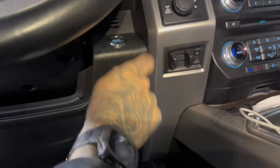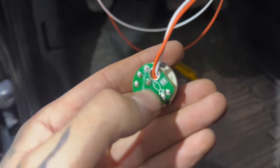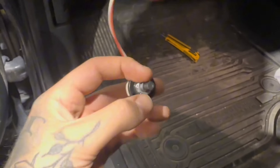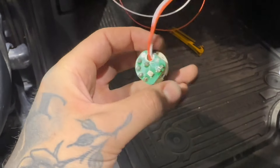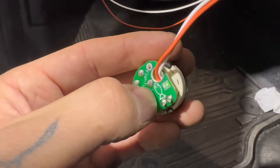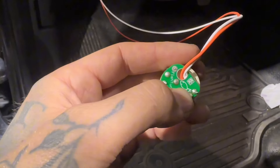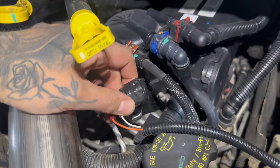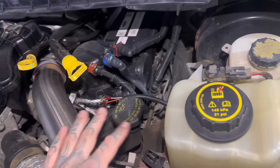Before buttoning it all up, let's make sure the switch works. Come into the truck, turn it to run, grab the switch and press the button — you'll see the green light turns on. Make sure it's all the way in the number one setting to the left; as you rotate right and press it, the green light gets dimmer. Rotate a couple more clicks and it's barely visible — we know our switch is working. Back in the engine bay, leave the sensor unplugged and tape it up to keep it covered, then zip tie the cable nice and neat out of the way.